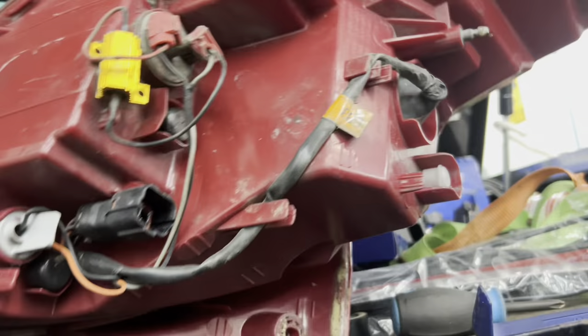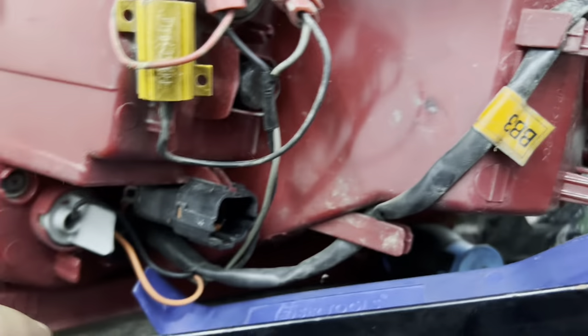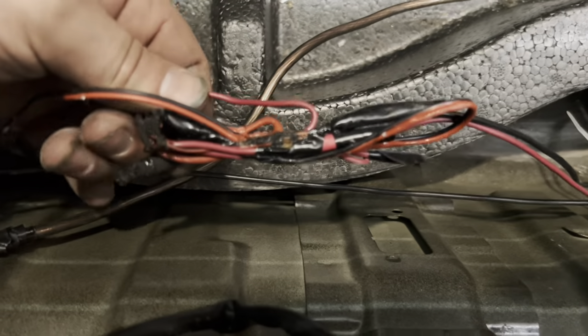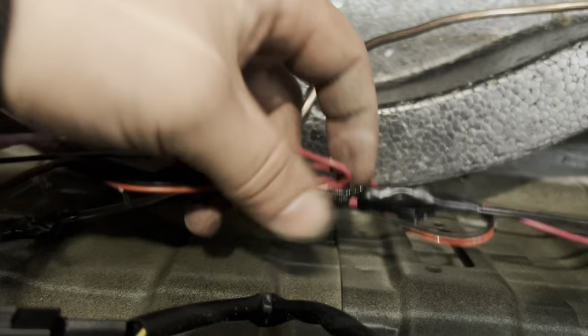I took the taillights out. Something told me to take the taillights out and just check the bulbs, since we just put LED high beams and HIDs, headlights in it. And I see all this crap. That's just glued on, not even screwed into place. And then this one, you can't even disconnect fully because he's stealing power from another light. Earlier in the summer, the car just randomly filled with smoke. I think this is all melted wire — all of that is melted together.